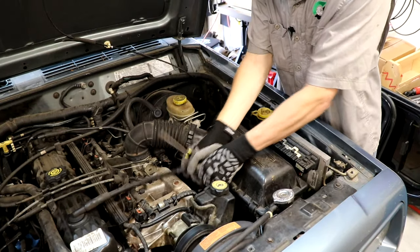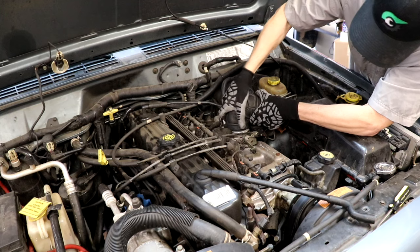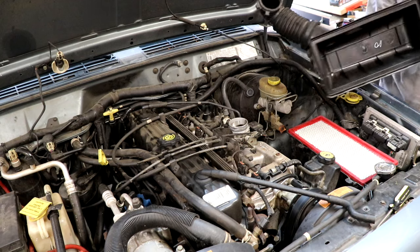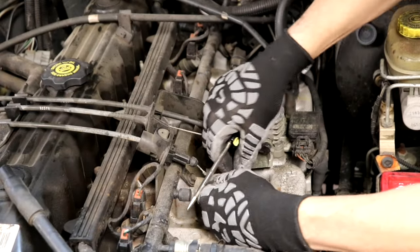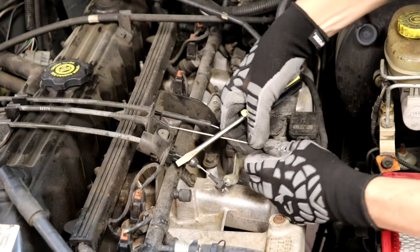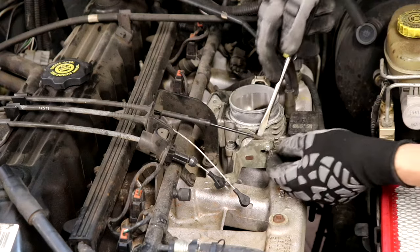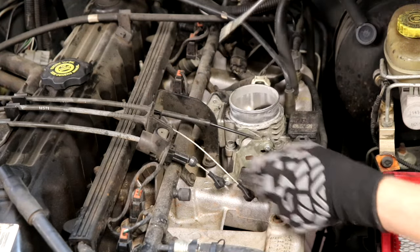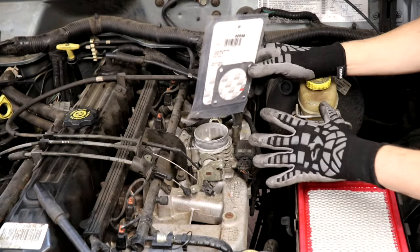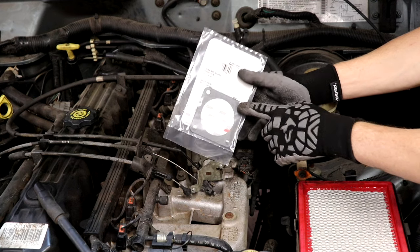Let's start by getting our air box out of the way here. My clamp is loose — it's stuck on there good but here it comes. I'm just going to push some of these cables down and get these connectors off so we can remove this throttle body. The other reason I'm starting with this as a diagnostic step is it's super easy — almost free. All I had to do was buy a new throttle body mounting gasket. These are like five bucks or less. I'll link these in the description below.